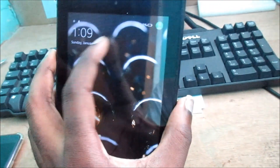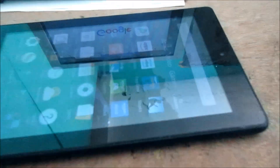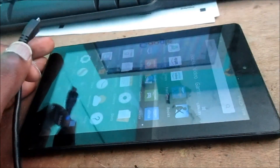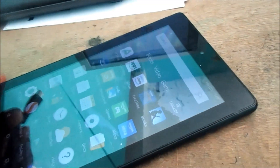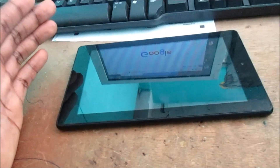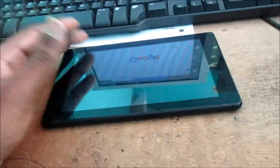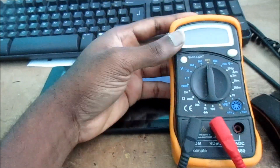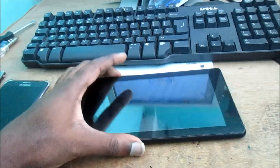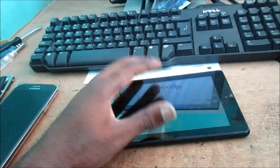I would be honest with you — the port for this Amazon tablet is a bit shaky, but it is actually still tight. When the charger is in, I realize that it is staying on for a long period of time. So I unplugged the charger and I'm waiting to see if this will turn off. It powered off. So what I am going to do is test the port and the battery connection area using this multimeter. I'm going to take this apart and do the necessary test. It could be that this tablet battery is dead and that the battery life for it is gone.